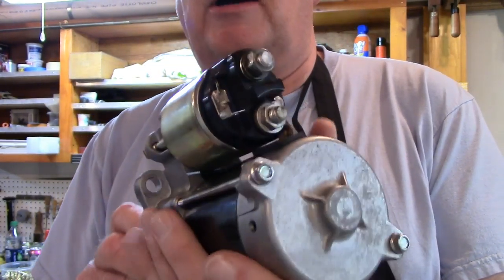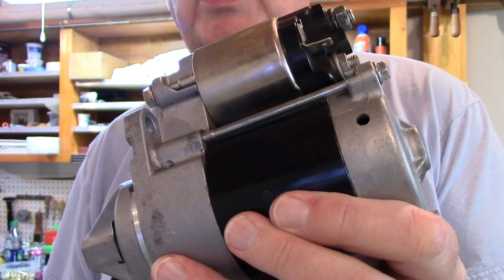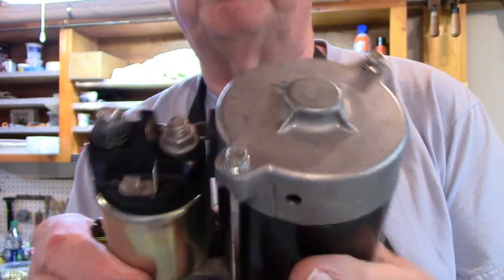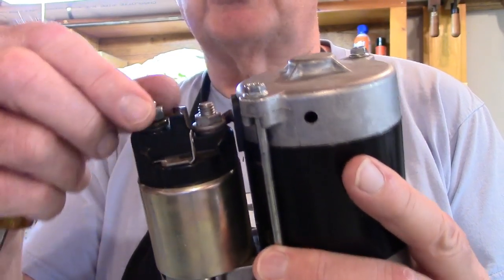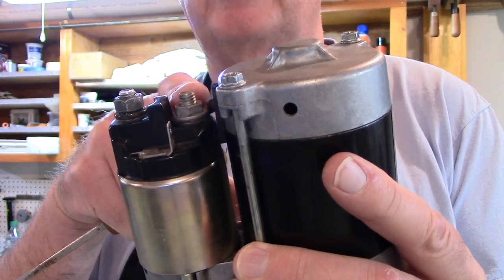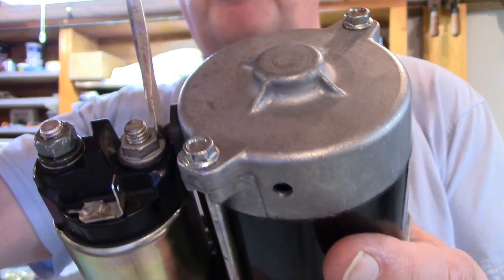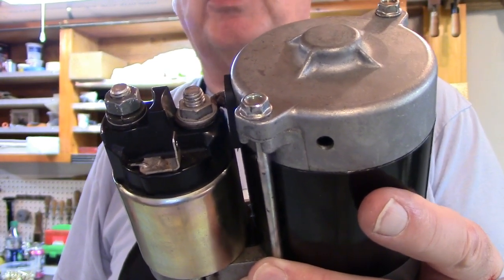Your solenoid is the component that mechanically closes the circuit between your hot and negative poles on your motor and drives the motor. How a solenoid works is very simple. You see right here the spade plug — this spade plug goes to your ignition switch, and this is also the hot lead direct to the battery. This other side is the hot lead that goes directly into the motor — it's called the strap right here. That braided strap connects the solenoid to the motor and energizes it, powers it when you turn your ignition switch.